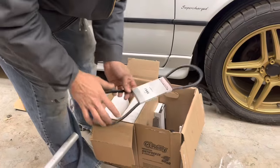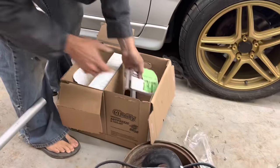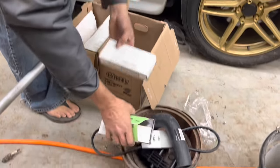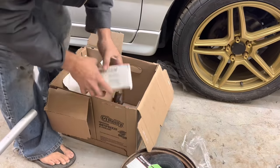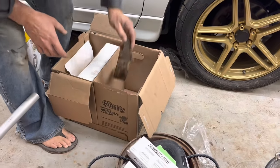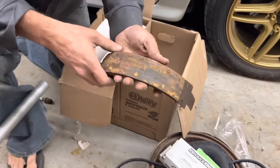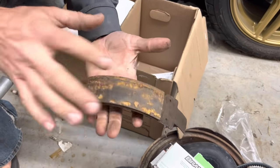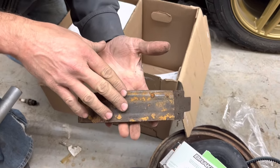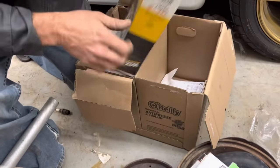Well, I went to the parts store and we got a little bit longer belt, a bigger lower radiator hose. We got some brake springs and cables and stuff that we needed. And they ordered some more brake shoes and they were also wrong. Apparently, these are for 10-inch drums, 2 inches wide. And when I looked up, the only thing I can find that came with that was like Fairlane, some Torinos, some Falcons. So we ordered brake pads for one of them.